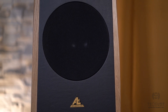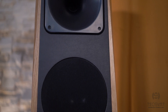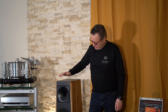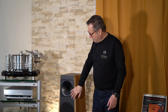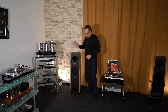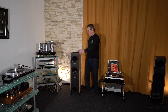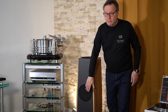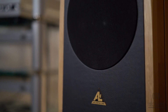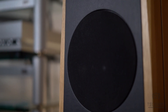The price-to-performance ratio is just unbeatable. These are two-way speakers — actually two and a half, though it's not really a half. The crossover is conceived as a two-way design, but the bass is also helped by an eight-inch woofer that is sustained by a rear speaker, which gives more speed, more precision, and more depth to the frontal woofer.